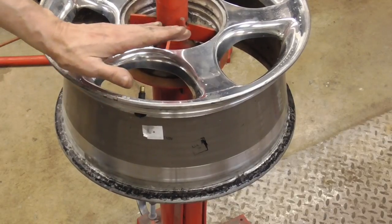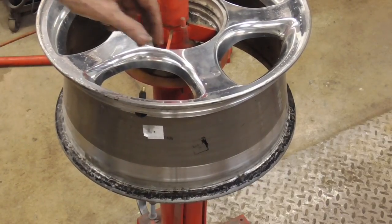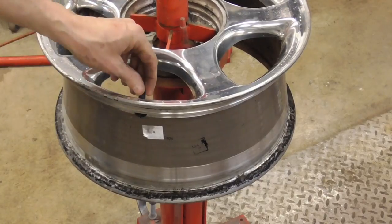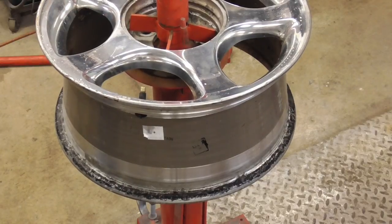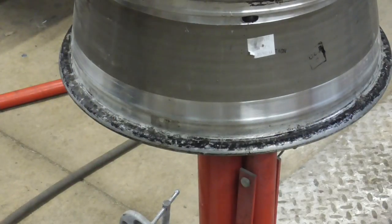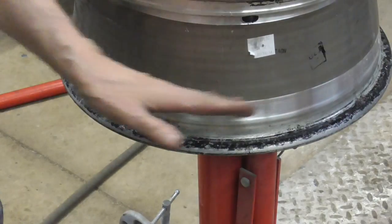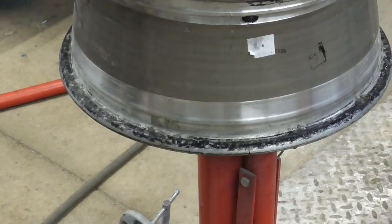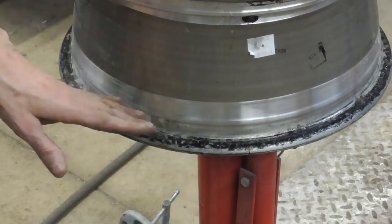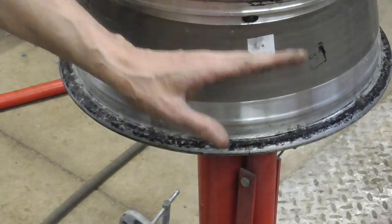There are two reasons that a new tire mounted on an old rim will have a slow leak: one is that the rim was not cleaned up well enough, and two is that it did not get a new valve stem when the tire was mounted. Also, you want to clean up the area in which the valve stem seats. There are a few ways to clean up the rim — one is with a drill and a wire brush. If it's a little rough or in worse shape, use a DA sander with 120 grit. You may have to prime and paint it to get a real nice smooth surface. If it's in really bad shape like a steel rim with rust, you might have to use a grinder, sandblast it, prime it, and paint it. The idea is to have a smooth surface that the tire can seal to.